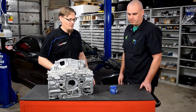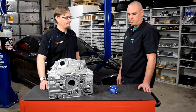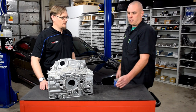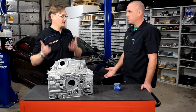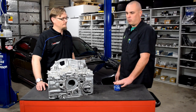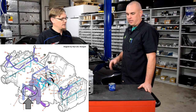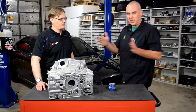We found a post from Outfront Motorsports about the same type of issue — not being able to get oil pressure to prime up. What they explained was: as we always do, we fill the oil filter up with oil before installing it on the block. Most people do that during oil changes. The theory is that it makes oil get into the engine faster. But what Outfront argued is that when you fill it completely with oil in a dry startup scenario — where there's no oil in the system already — there is an air gap between the pump and the filter.